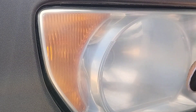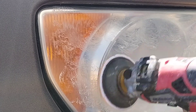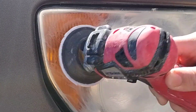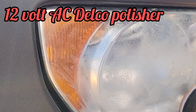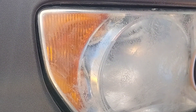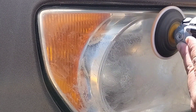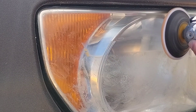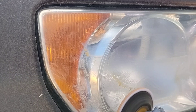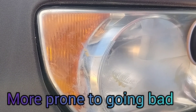When lights are soft, they are easy to work with and easy to restore. But they just don't last as long as far as headlight restoration goes — whatever you're surfacing them with, spraying on, or coating them with. The headlight restoration life is not going to last as long because they're softer.